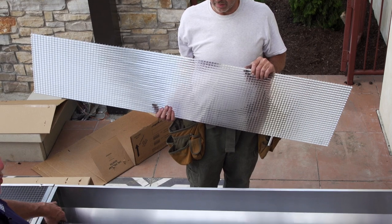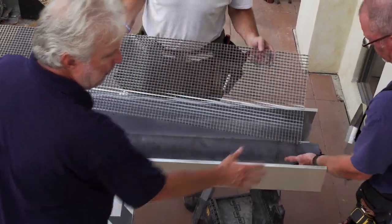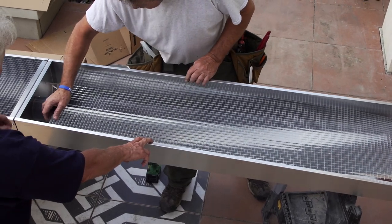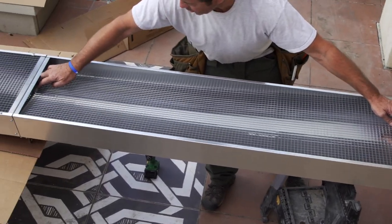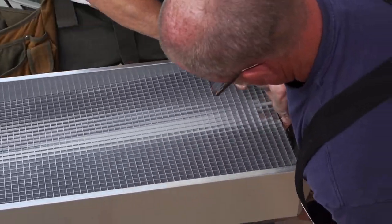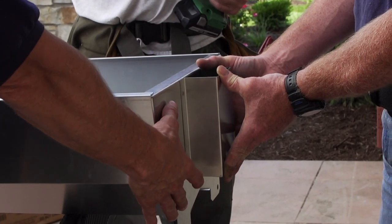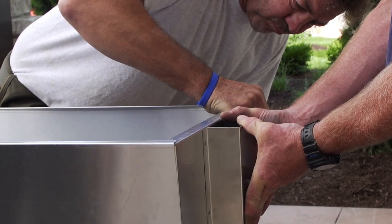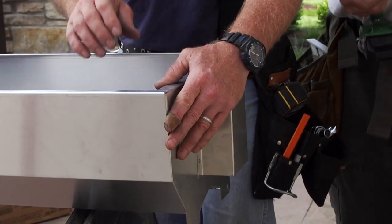We've got the auxiliary pipes now screwed down, and in place we want to now insert our auxiliary or 5-foot piece of grill. We want to temporarily slide our panel out, get our grill inserted. Spreading apart the reflector is always helpful — it makes it easy to slide that grill in and get it underneath the outer lip of the reflector. Now that we've got the grill in, we want to get our end panel back on. We've slid our end plate in, now that we've got our tube and our grill inserted, and Dan is going to insert some screws — just two screws to hold it in place. We'll put the rest of the screws on after we lock our grill in place.